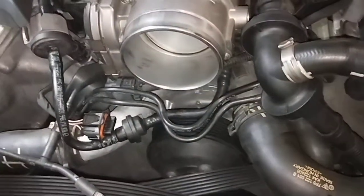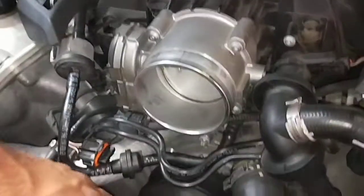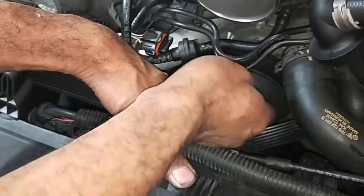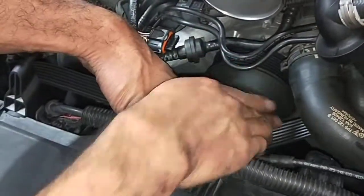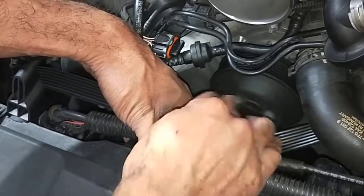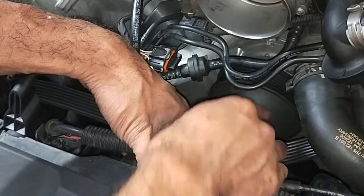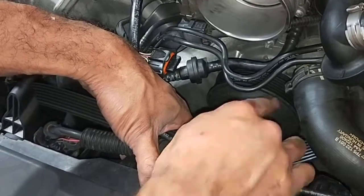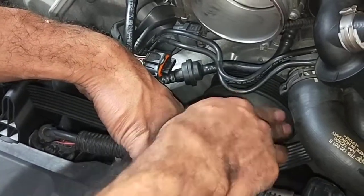Okay, now I am going to check the pulley. We will start with the water pump. As you can hear, the water pump is really noisy — it is starting to be noisy. Especially when you are spinning it at high RPM, you can hear the axle disc whine.